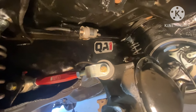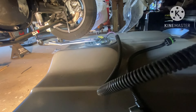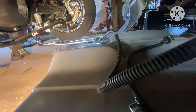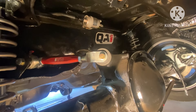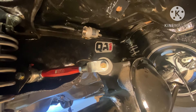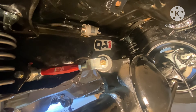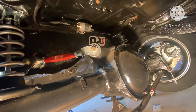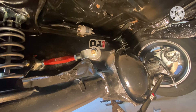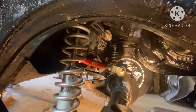This fuel pump is actually the same size fuel pump that I got in the donk — it's a 340 pump because we're going to upgrade. We're going to put an LSA blower on here later down the line, so I put a little bit more pump in the tank to support that. I might even do away with the regulator once we get to that and install a fuel pressure regulator under the hood to account for the LSA, because it's going to need bigger injectors and more fuel. I'll probably get away from the Corvette regulator slash filter because that may starve the engine for fuel. I'd rather be safe than sorry when running a power adder.